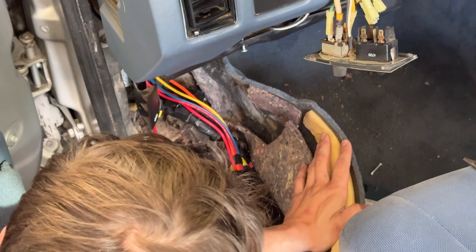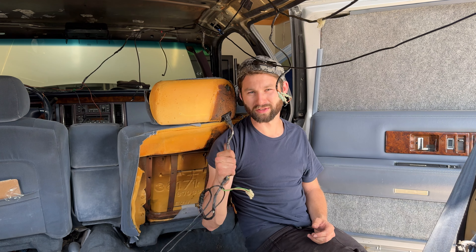Oh my god, game changer — we also got the lights to work on the doors! It looks bad right now but we're actually making progress. We've traced the power wire for the dome lights down to an orange wire and now to a purple wire, which is going under the carpet towards the glove box area. Trust the process — we're making progress and finding more electrical gremlins.